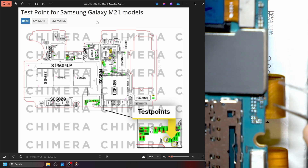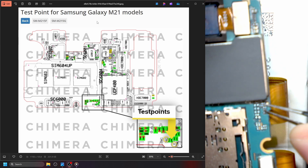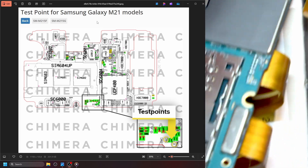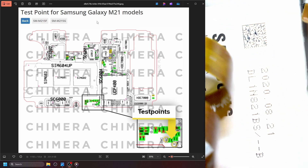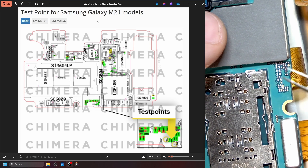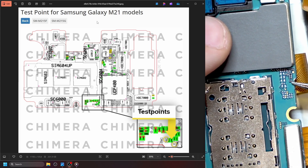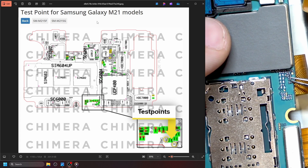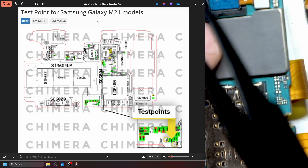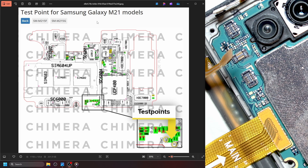It is hard and it's meant to be hard — it's very normal for it to be difficult. This little circle right here needs to be touched, and this second pair of pins here — it's very difficult, but once you touch both and plug the phone into the computer, it should be working. The circle is the first pair of two little pins, and here is the second — both need to be connected at the same time with the same tool to open service mode.